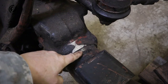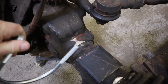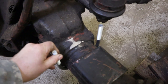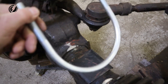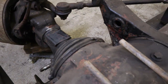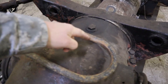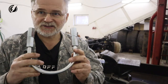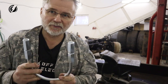We are going to use this groove over here where the weld is, and place this U-bolt exactly into the groove — it should fix it in position. Our bracket is on the top of the axle, so there will be no weight on the U-bolt. Otherwise there would have to be a much stronger one like this one, which is originally on the rear axle where the axle is a little bit wider than the front one. They are strong and affordable, but they have a different distance between the bolts, so we need to modify them a little bit.